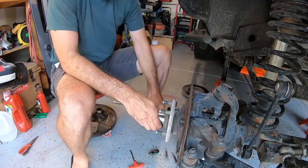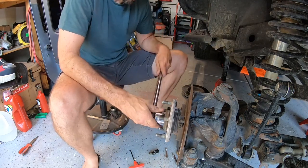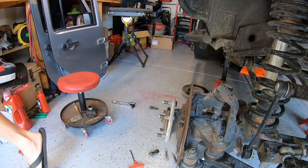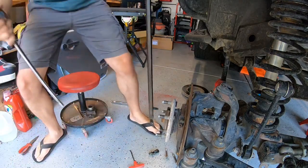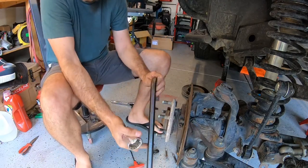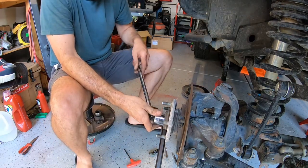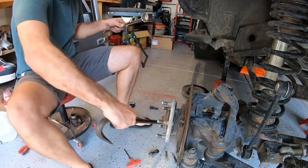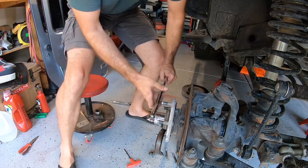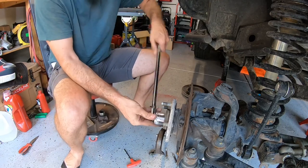This 36 millimeter is going to want to cause the axle shaft to rotate, so the only way you can tighten it when putting it back together or loosen it to take it apart is to use a long pry bar or crowbar. You can insert it into the studs on your unit or hub bearing and prevent it from rotating. I set it up this way just to show you on camera, but we're gonna have to flip it around to face it in the other direction so we can loosen it and spin that 36 millimeter off.